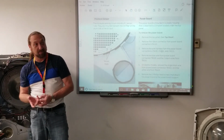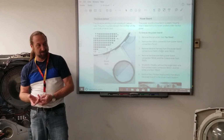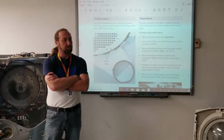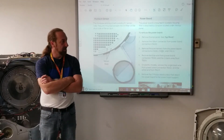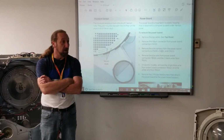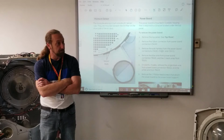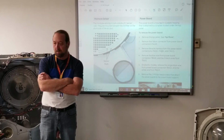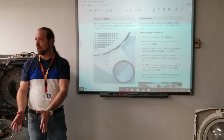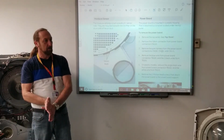The automatic, if it's dry like 20 minutes before, it will stop. But the time dry will work until the time requested to stop. So if I set the timer to 60 minutes and the clothes dry in 30, I'm wasting electricity, right? Right. So automatic dry is better, because it'll stop the dryer when the clothes are dry or close to it.